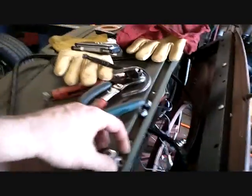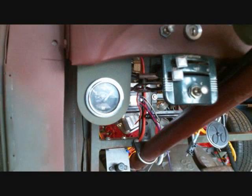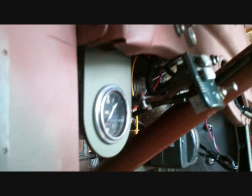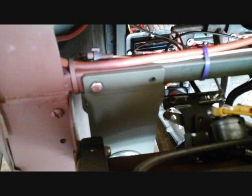The other day I was like, hey, I got a bracket. I had the Stewart Warner fuel gauge with me, and I'm like, I don't ever remember seeing a hot rod where the fuel gauge was in the center anywhere. Always seems to be over near the key. So, made one. That sticks up 4.5 inches, and it's got two bolt holes. There's actually right there, there's a little tab on both sides. Let's see if I can get you in there. This little tab folded back, I made a slit so it could bend. And I painted it camo green. I haven't drilled the second hole yet, but next time the dash is way down, I will.